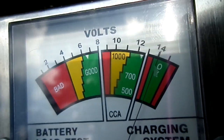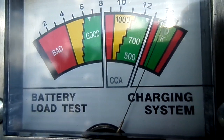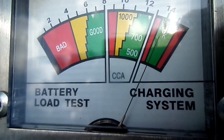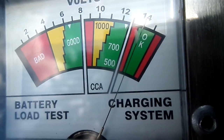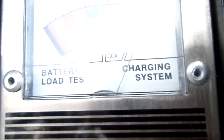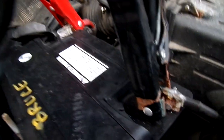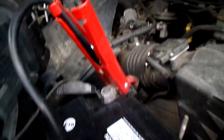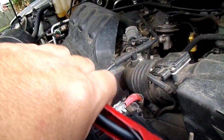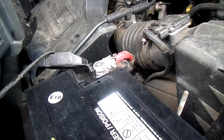You heard it first on the Car Man's channel — checking a load on a battery. Simple enough. I will not say this is 100% accurate; it's just a tool to help you gauge if something is really bad. It will tell you if it's really bad. This analog is off just a little bit, and this is actually a Blue-Point Snap-on, a really high quality tool, but it doesn't mean it's always accurate. In closing, always remember: take the negative off, then take the positive — and that equals no explosion. Same as if you're jumpstarting a car.